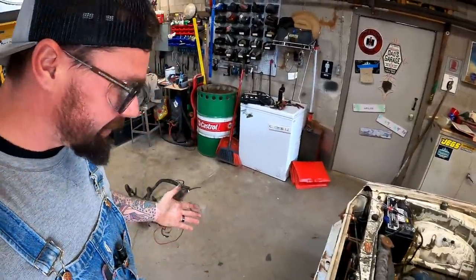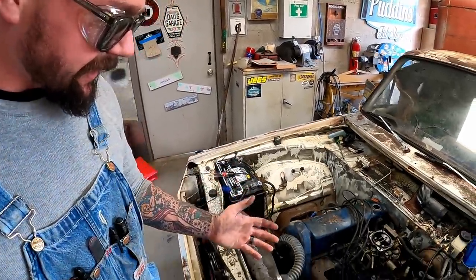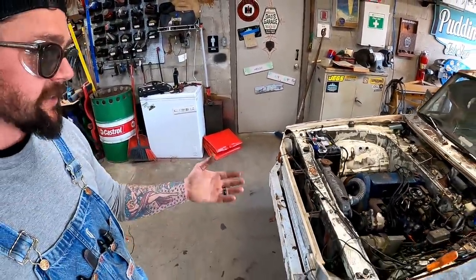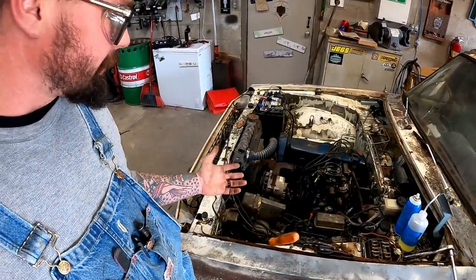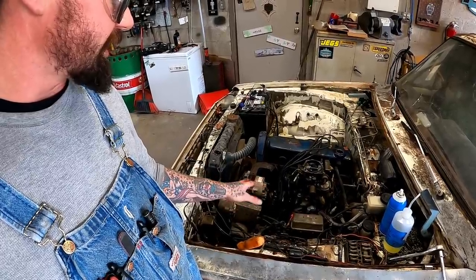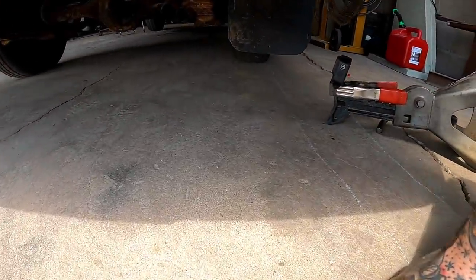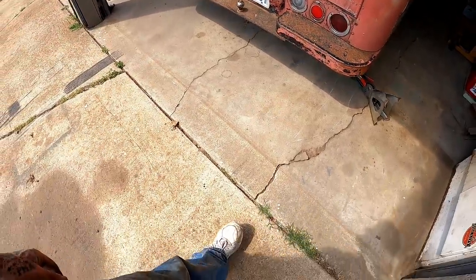You damn right, guys. We must be getting close on her with our timing, I'm guessing. I did kind of shoot fuel everywhere, but I sprayed some up in that carburetor and it seemed to be drawing it through. Nice little couple quiet revs. I think what we need to do now is get our distributor free where we can really mess with timing and try to tune her out. And we need to hook up a fuel system. Of course, the one time I turn off the old tailpipe cam, she fires up. She didn't shoot nothing out anyhow.